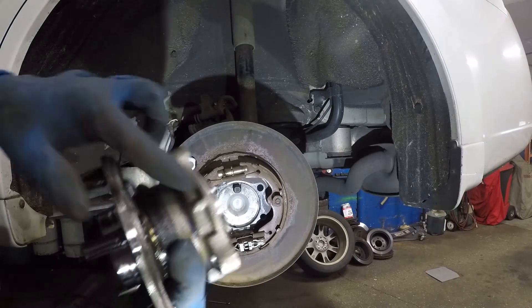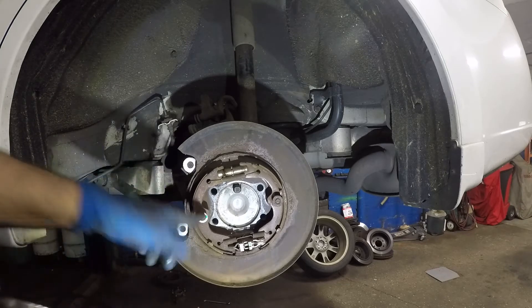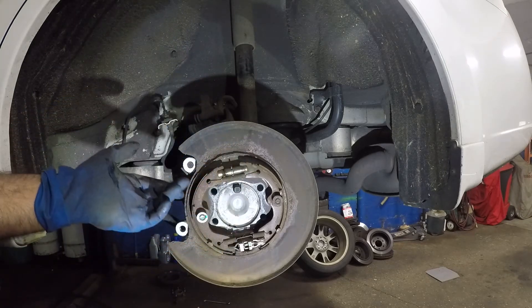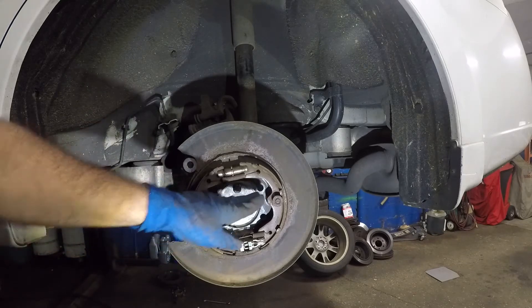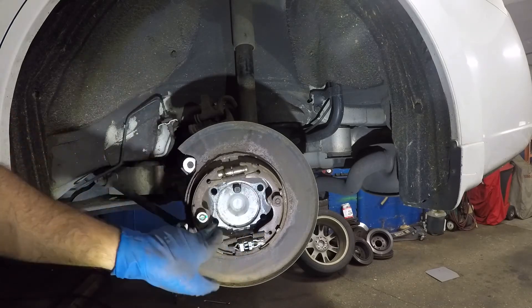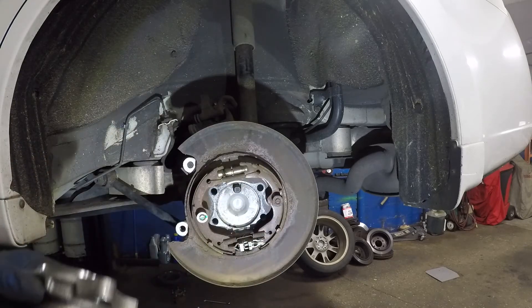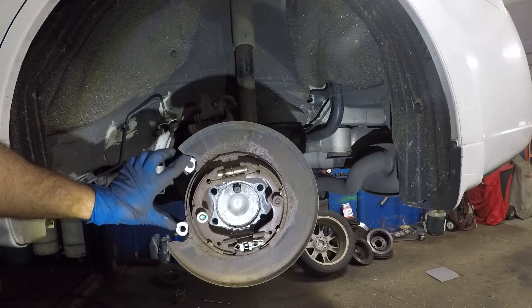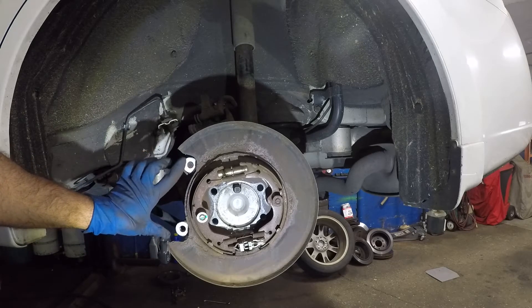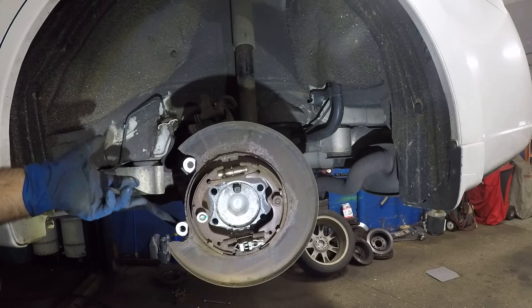We got our bearing — this thing is going to go up this notch. The torque specs for the four bolts is 87 foot-pounds, but tighten them in sequence. Tighten this one first, then that one, then this one, this one, and then give it a touch around. The two bolts over here are 38 foot-pounds. The other two 14 millimeter bolts are 28 foot-pounds.